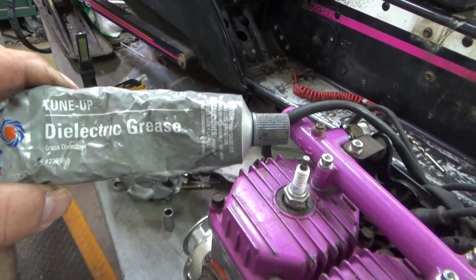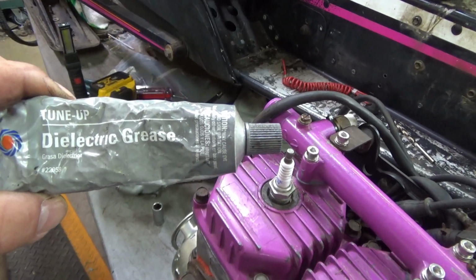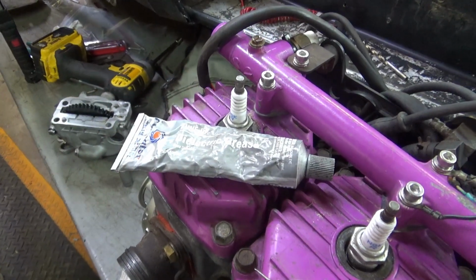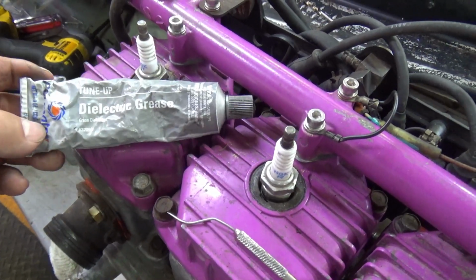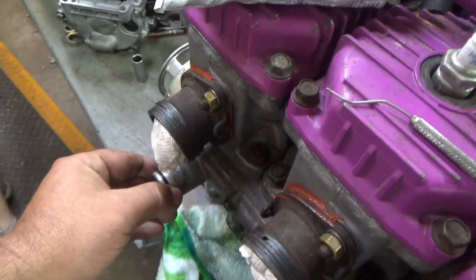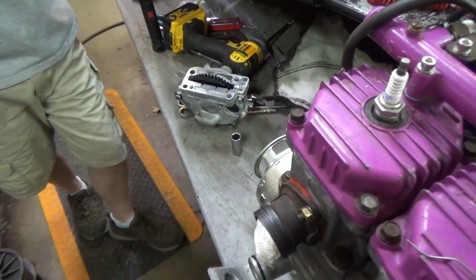It's just dielectric grease. It's just silicone grease, and that's what fancy O-ring grease is too. If you're doing some precision, super medical thing, get the right stuff for $100 a tube. But otherwise, for the rest of us, this $5 a tube dielectric will work just fine when we put this on. So here, Dennis, you want to give her a smear and see if we'll get the pump on or not?